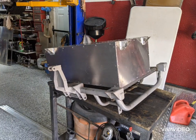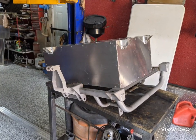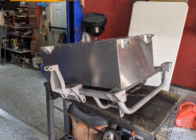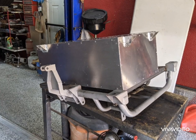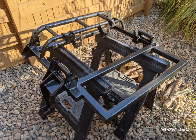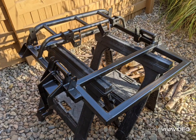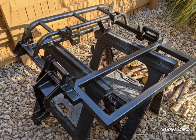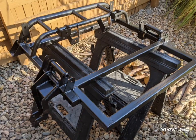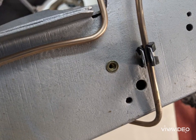With that done, I pulled out the K-member — this would normally hold the engine, you can see the suspension mounts on the side. I'm ready to paint this, so I took it outside and got a number of coats of paint on it. While it was drying in the nice sun — I had some warm days for this — it cured really nicely.